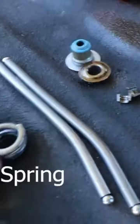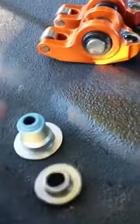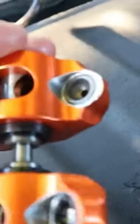Got the bent rods, broken valve. Thankfully the retainer clips didn't go down in the engine — got the valve, had the keeper. Unfortunately, pretty sure this rocker arm's done. Yeah, there's a few things bent, so I am a little worried.